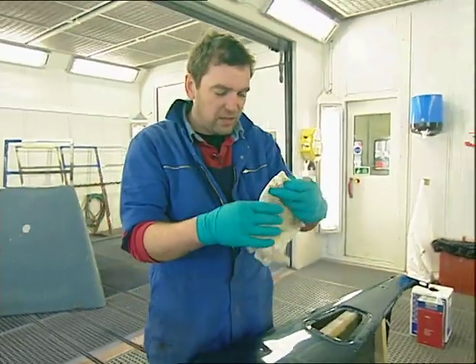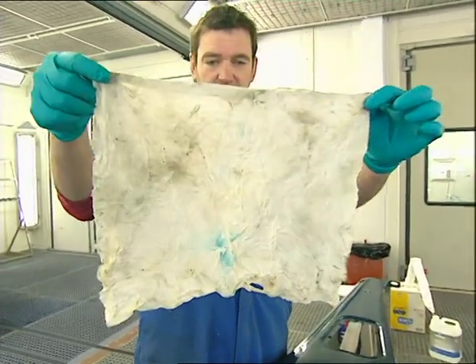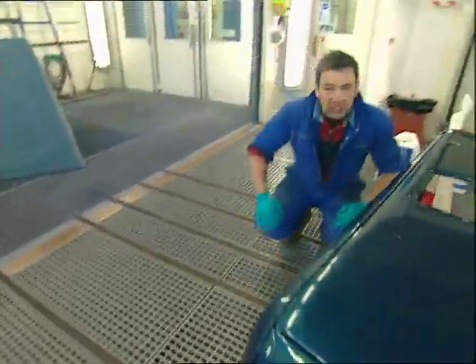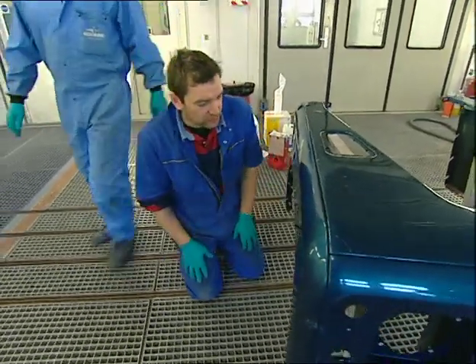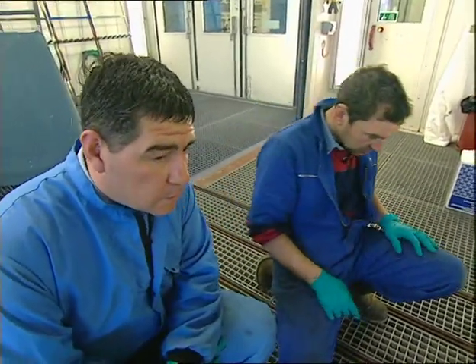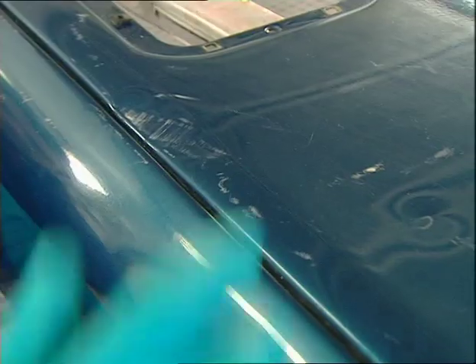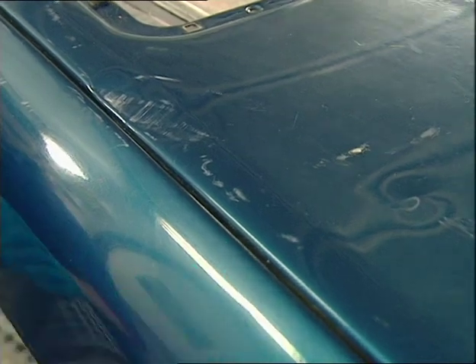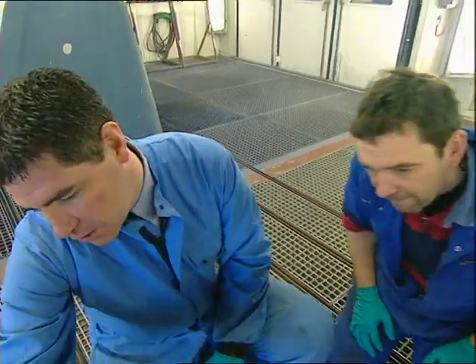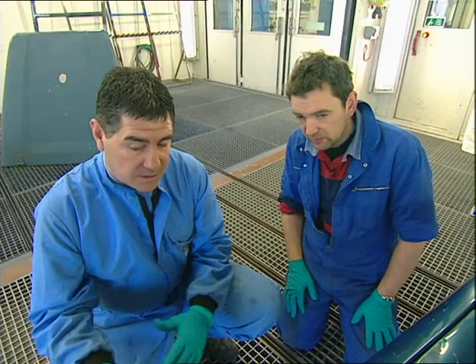It is amazing — I steam cleaned these at about 1:30 in the morning and thought I got them really clean, but look at the state of that. Right, they're all cleaned up — these two wings — so it's time to assess the damage. This panel is much worse than the other one, so let's go through and identify what we've got to fix. We've got what we call an outward dent here where something from the inside has pushed out. On the top here we have a couple of normal general dents — one looks like something was dropped on it, a bit of a car park dent where somebody opened a door onto the wheel arch. There's also a small knock on the front corner which is quite deep, so we'll knock some of it out from the inside first before attempting to fill it.